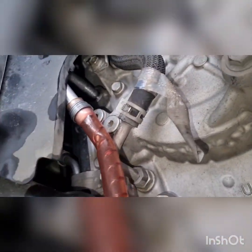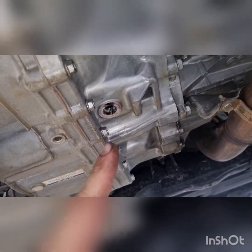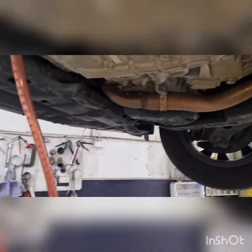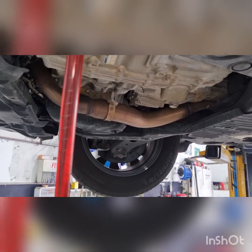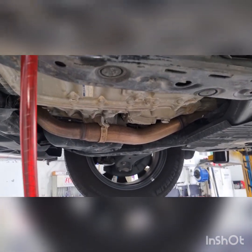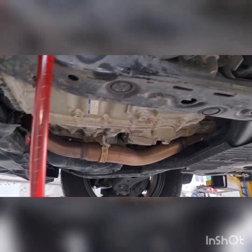Okay, so here we've got our plug in the back of the gearbox through that 24mm, and underneath we still have our drain plug out, but our check level plug has been screwed in. Don't do that overly tight — it's plastic, only needs to be nipped up very slightly. We've got our drum, going to start pumping it in — should take about 25 pumps before it starts coming out. I'm just going to watch underneath here. When it starts coming out, I've got the co-worker in the car — he's going to start the car and pull it through the gears.